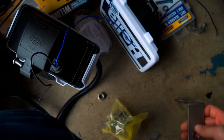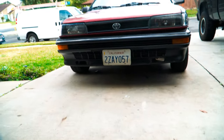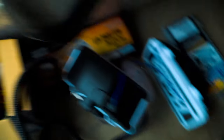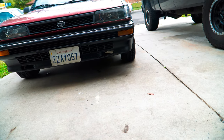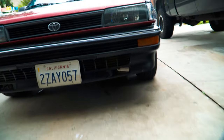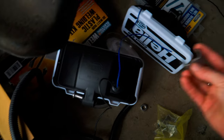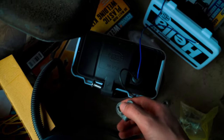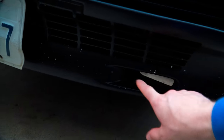What I did slightly off camera was start building some brackets for the actual lights, because I don't want to drill into or mess with the bumper that I put on. I made these little L-brackets — it's going to bolt to the bottom of where the actual tow hook spot was in the car. As you can see, I've kind of already mounted that one up. It's going to have to extend a little bit longer, so we're going to weld another piece that will go on the back side of this, which actually goes right here to swivel the headlight and extend out through this spot in the car.